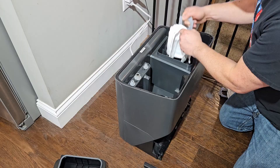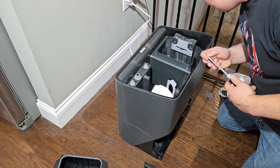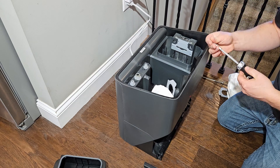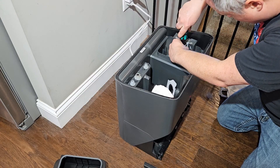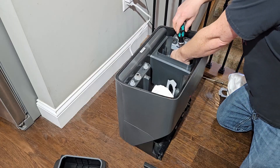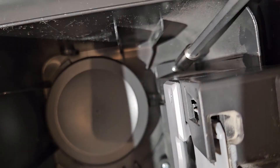I'm going to pull the bag back out — we can reuse this. There are a bunch of screws right here that I'm going to remove. You will want a number one Phillips — it's the smaller Phillips drive. I'm just going to back these screws off. Those three screws are right here, right here, and right here.